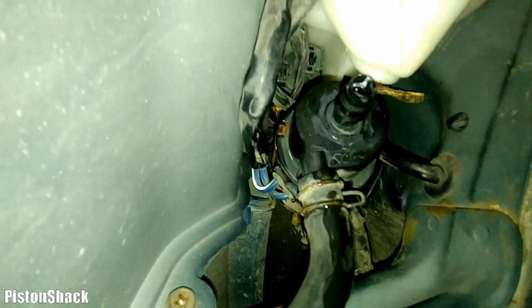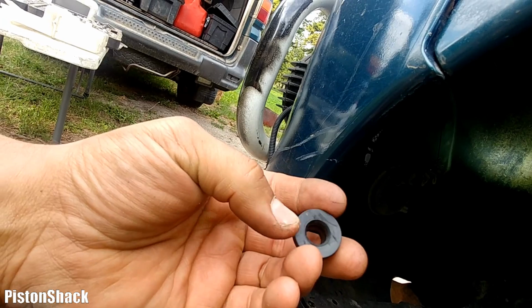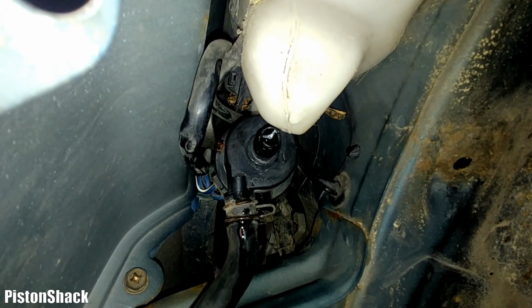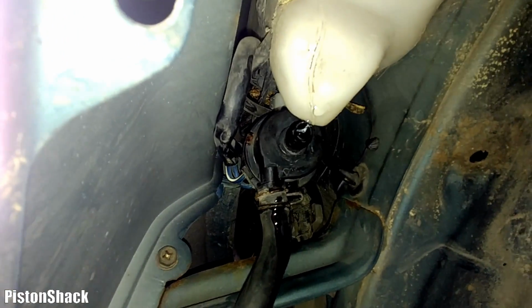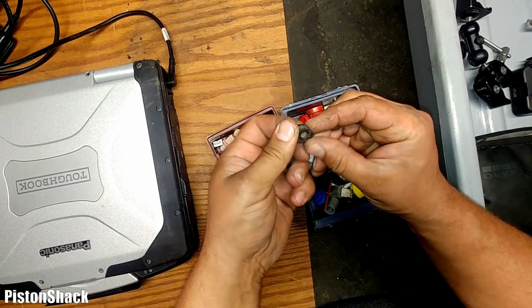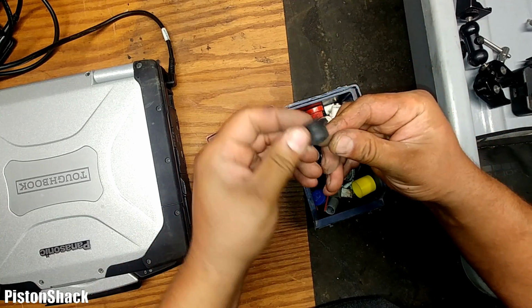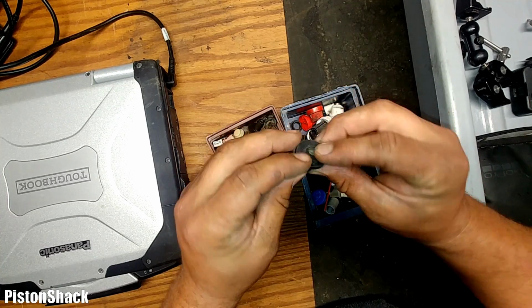Here we go. I pulled the headlight sprinkler pump off, and I also removed the grommet, and this is our diameter. We'll find a plug, and for now we'll just plug the hole and keep that pump like that. Eventually I have to find a replacement pump, because this pump is leaking, and get those sprinklers fixed. I found a rubber cap from a brake bleeder valve, and it fits tight and snug inside the hole. Perfect. They were made for each other, rubber on rubber, and they sealed.